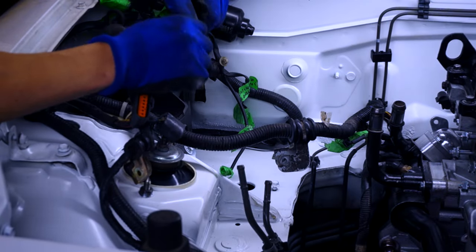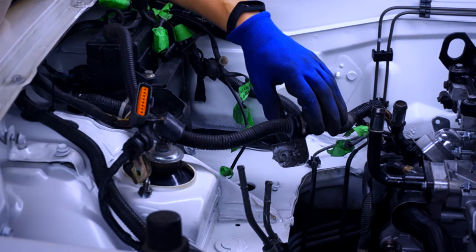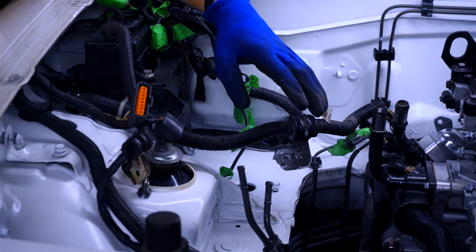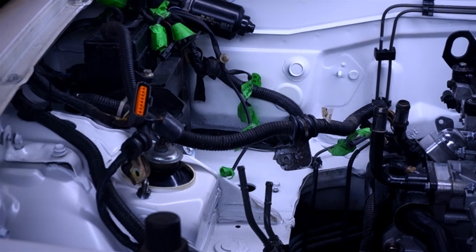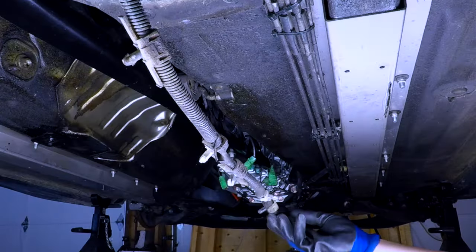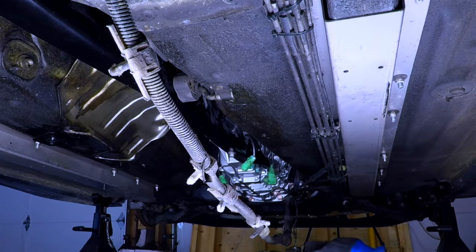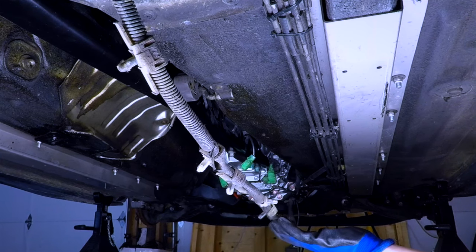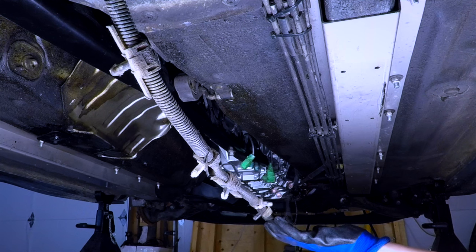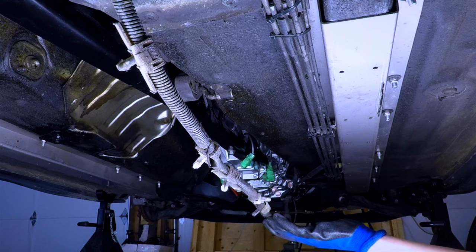On to the part of the build that I've kind of been dreading — and that is the wiring. Over here we have the stock Miata wiring harness that, if you'll recall, I used green tape to label. A lot of the connectors will remain unused and I'll tuck them in behind the fuse box over here. However, some of them will be used, like the oil pressure sender. Underneath the car we have this wiring harness that runs from the battery in the trunk up along the PPF to the engine bay at the front and provides 12-volt power to the starter. But I'd like to replace that 30-year-old power wire with one that's newer and of a thicker gauge, and run it along the driver-side frame rail.